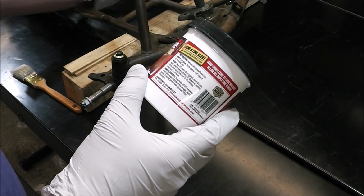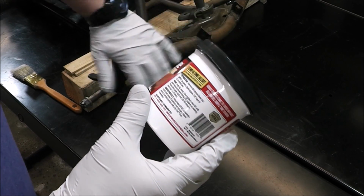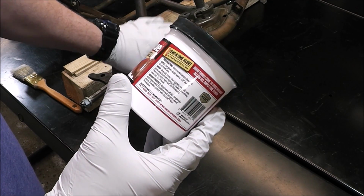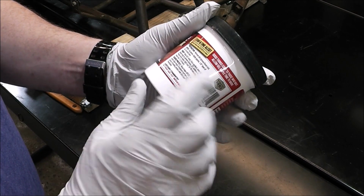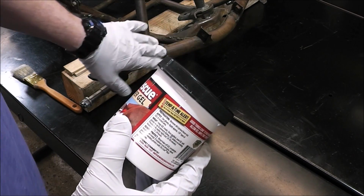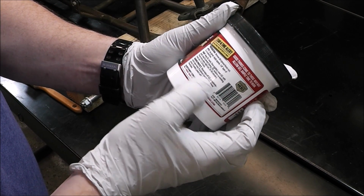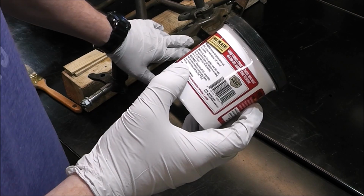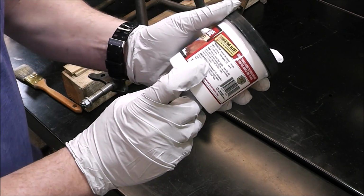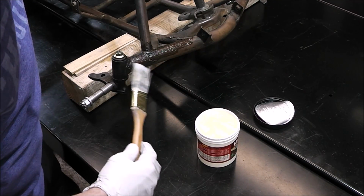So remove all the grease, loose dirt, and so on. We've done that. Use gloves, put on 1/8-inch layers of gel, and then when you get the gel on, wrap it. We're just going to use cling wrap and leave it on for 30 to 90 minutes for light rust. We'll try that, because this is light. This isn't like scaly shale or anything. And then rinse or wipe off the gel completely. The results will be bare metal. For light rust, 30 to 90 minutes. For heavy rust, 12 to 24 hours. The reason it's a gel is so that you can use it on vertical surfaces.